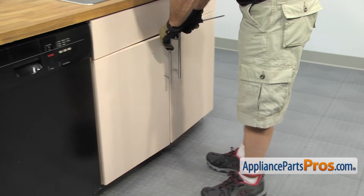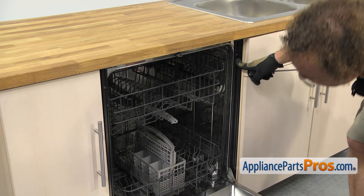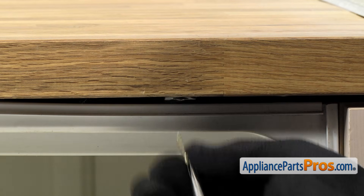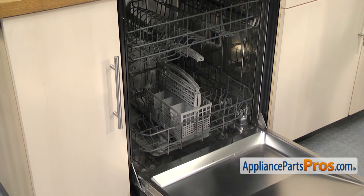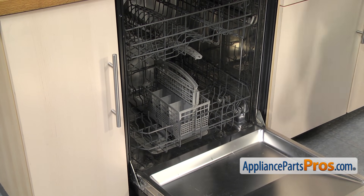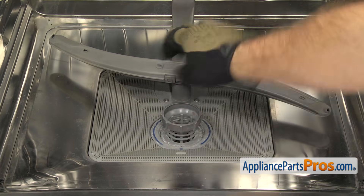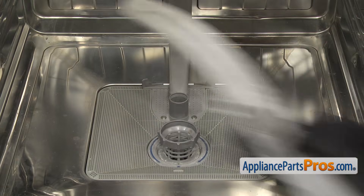We need to remove the line and we can take it off with a 5/8ths inch wrench. Now that we have the lines disconnected underneath the sink, we can open up the dishwasher door and take the screws out that hold the dishwasher to the countertop. We're going to use our Phillips screwdriver to take them out. Before we pull the dishwasher out of the cabinet, we have to take some stuff out of the bottom of the dishwasher. First thing we're going to do is take out the lower rack and set it aside. With the dish rack out of the way, we're going to remove the spray arm. All you have to do is lift up on it to unsnap it, pull it out and set it aside.